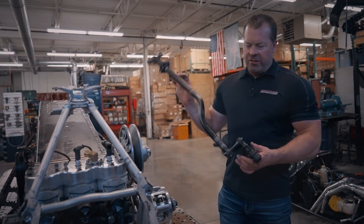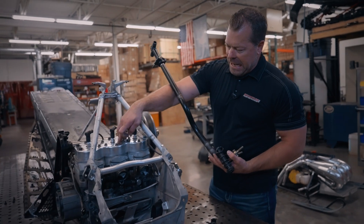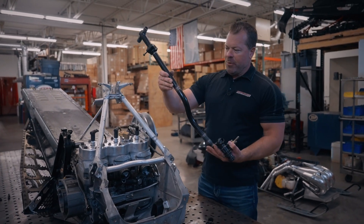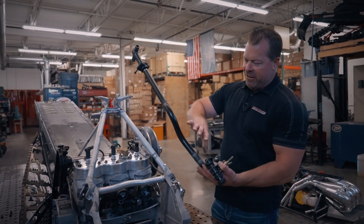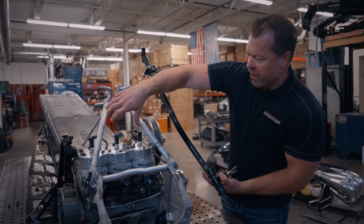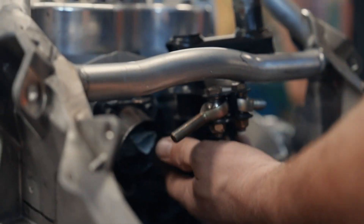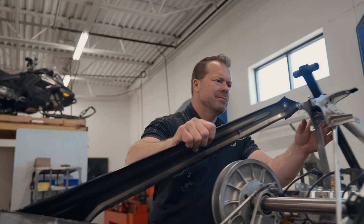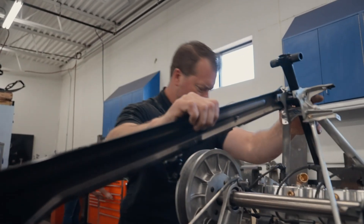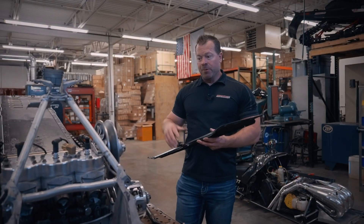Let's run over some of the items here. The steering post was interesting — we're putting the Pro Stock 1000 engine in here, and the steering post needed some shortening, some turning, and some extensions down here to get it up and through, because by the time we fit some pipes the steering post is right in the way. We got some modifications there, we'll get this put in and show you how that worked. We've got some of the upper structures here we'll get mounted, then we'll talk about the back stuff we modified and the changes needed to get this in here.